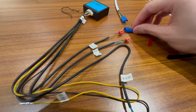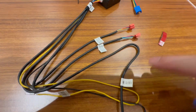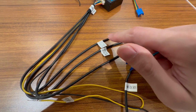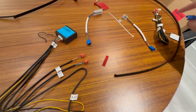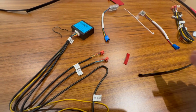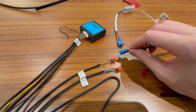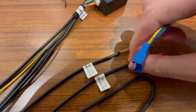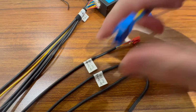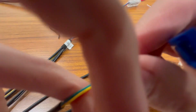So we've got a quick disconnect. We're going to keep it on zone 2. So in case you want to have different lights on zone 1 and zone 2, zone 1 being the blade light. If you want to have a purple light on there, running at 50% brightness, and then you want to have a white light on the lower part of the door at, let's say 20%, then we can wire it to this zone 2 cable.